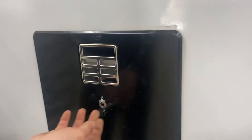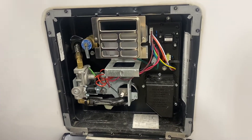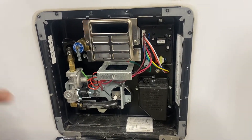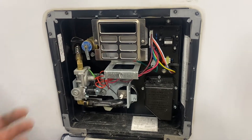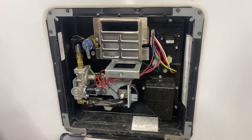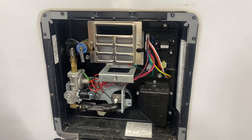Around the back of the unit, right in the center, you've got your hot water tank. You get that one little keyway — line that up and it pops open. All of your controls for turning this on are just inside the unit. Before you ever turn it on, you want to hit this relief valve and make sure a shot of water comes out. We've got no water coming out right now because the unit is currently winterized. If it were full, you would get that water out, just letting you know it's safe to fire it up.